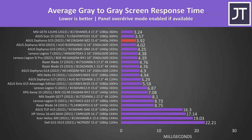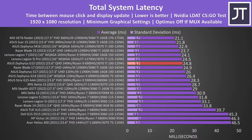As for the screen — that's what you're actually going to be looking at when playing games — we're looking at an average grey-to-grey response time under 4ms with the 1440p 240Hz panel, an excellent result. It's only slightly faster compared to last year's 165Hz version, but last year's G15 screen was already quite good in this regard. The total system latency, measuring the time between a mouse click and when a gunshot fires in CSGO, shows this year's G15 offering a decent result compared to other models.